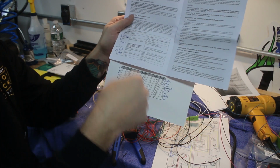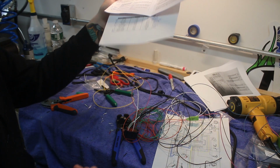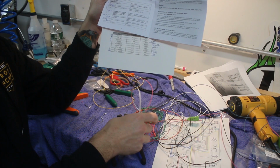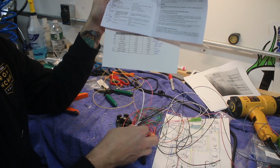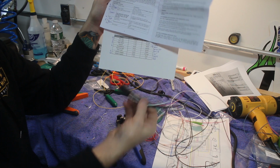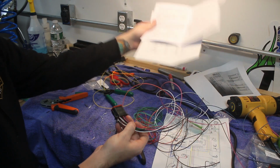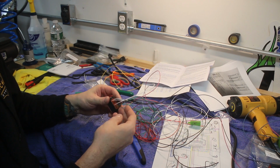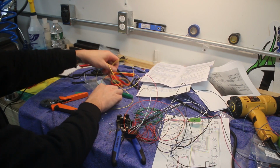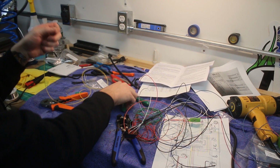Same goes here, it's just a different way of writing it down, but basically we had these 12 pins total. And then once we come here to do the bike side, it's pretty easy to say, okay, we know which wires now. Basically just plug all of these color wires that I wrote down into these pins on the bike side of the harness. So that's what we've been doing. Basically, it's pretty simple. I've got one last to do. I'll just show you how that works.